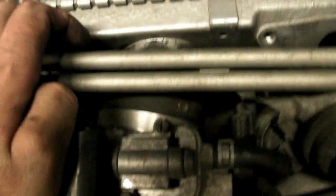Disconnect your blow-off valve with two bolts. You may want to buy a gasket ahead of time for that. Then you're going to need to loosen the clamps on your throttle body where it connects to the intercooler, and there's also another clamp down here where it comes off the turbo. Take that clamp off and then your intercooler is just going to lift right out of there — like so. And that's what it looks like without the intercooler. You can see your transmission, starter, and turbo.